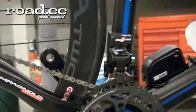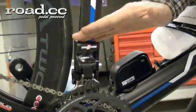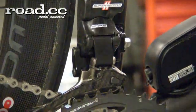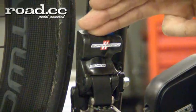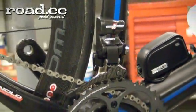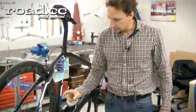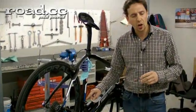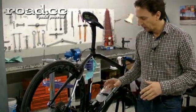Front derailleur. The front derailleur inside has an actuator. What does that mean? It means there is a motor with a gearbox, and also we have a resolver. A resolver is an electronic device that allows you to know at all times exactly the direction, speed, and position. Inside here, there is all of this. We also use a special plastic material to increase stiffness — this is not only a simple plastic material. It is a technopolymer with carbon fiber inside, just to increase the stiffness.